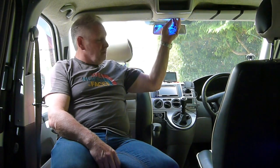Just thought I'd do a quick video to explain how I fitted LED lights into my camper van that are actually linked to the courtesy light. So when you unlock the car the internal blue lights come on and then when you lock it again they go off again. It's actually fitted into the main courtesy switch here, so you can have them on all the time or you can just switch them on so when the doors open they will come on.